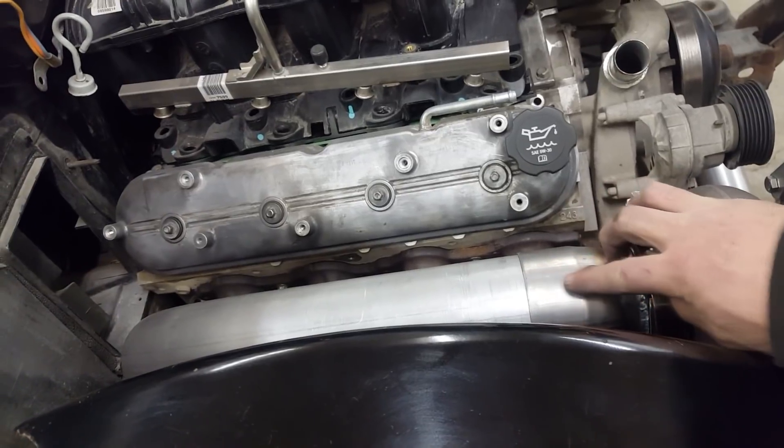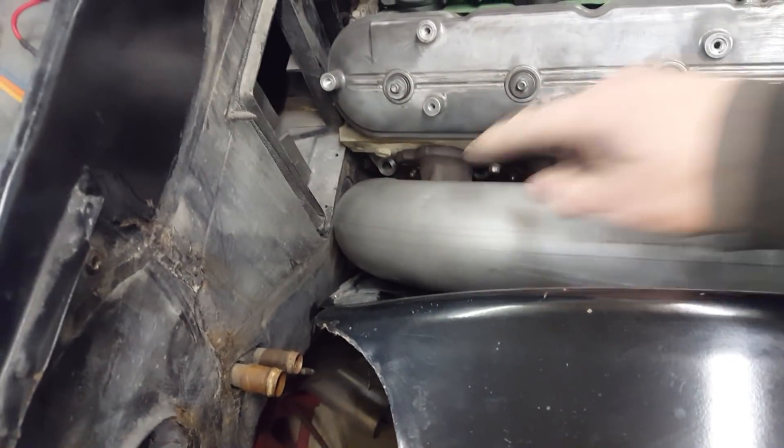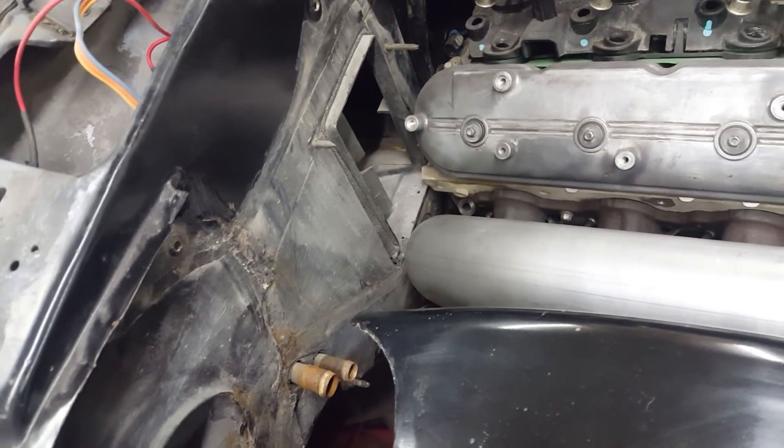So I got that welded on there. I cut the three and a half inch U-bend and fit it on there — so far it's pretty good. This joiner is actually stretched open so this slides right in. I'll end up cutting it back to here because I don't want the bigger piece — I'll cut it back and weld it. It goes there and turns. Obviously if I'm going to keep my heater, I'm going to modify the heater box. And then you can see it starts going down there. I have room to get the other half of the U-bend up beside the transmission and the frame, and then once it gets up there to join that pipe it looks like it might be a little tricky. I might need a few more bends — another U-bend or some 90s or 45s. Got a lot of progress this weekend. Pretty happy with that.